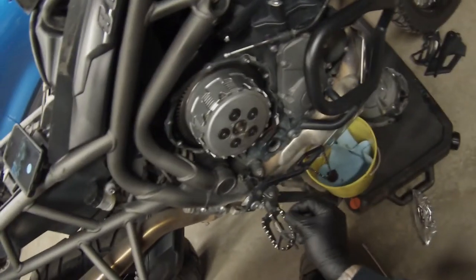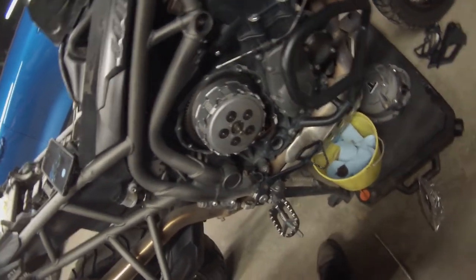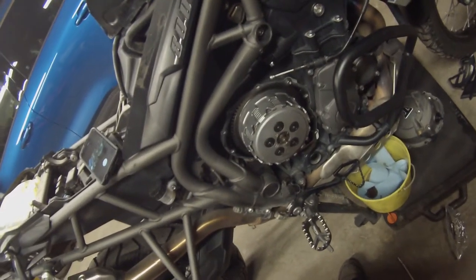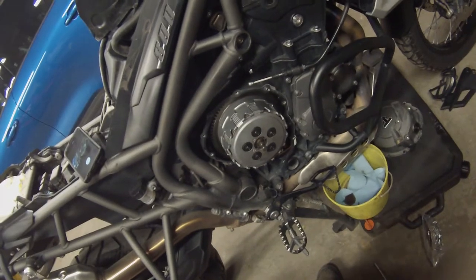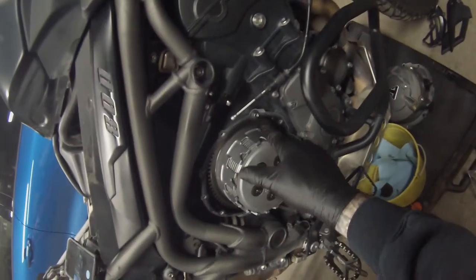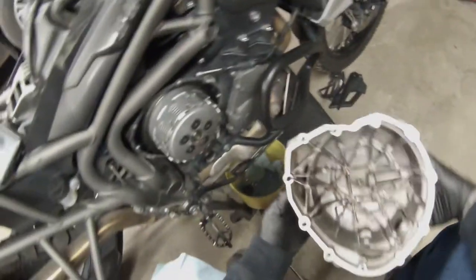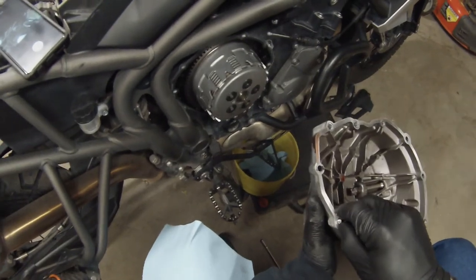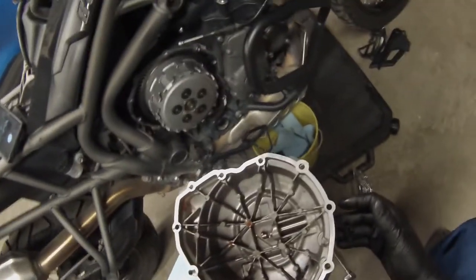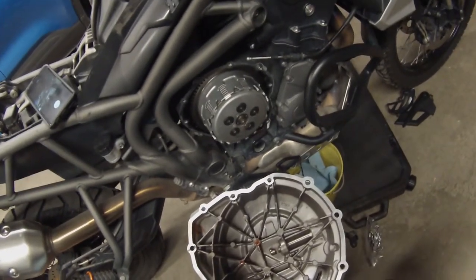This doesn't come out until after we take the pressure plate off. So you want to have it in gear when we're taking this pressure plate off, and the work instructions say second gear — I don't know if that truly makes a difference but I'm going to put it in second gear. The dowels must still be in the cover — we will transfer these over to the block a little bit later on. It also helps having the dowels up on top of the block because it will help keep the gasket in place.